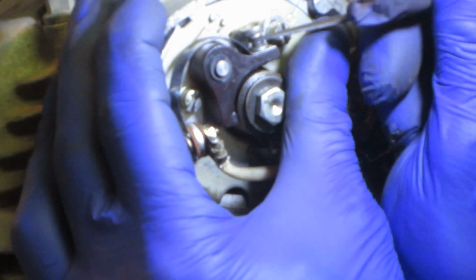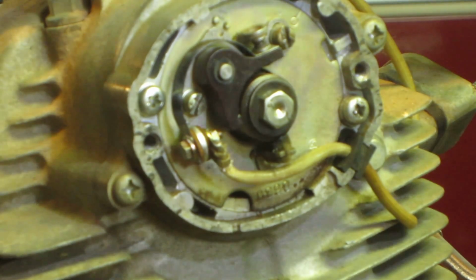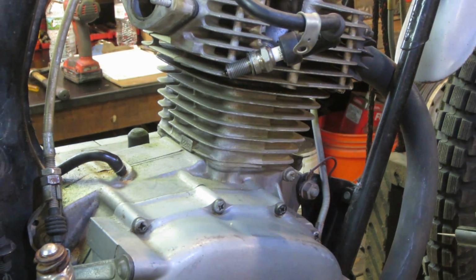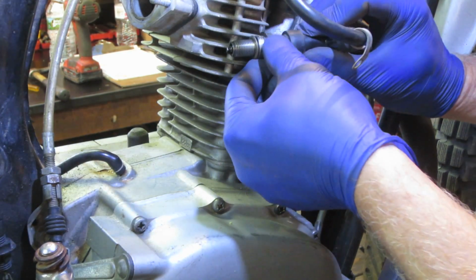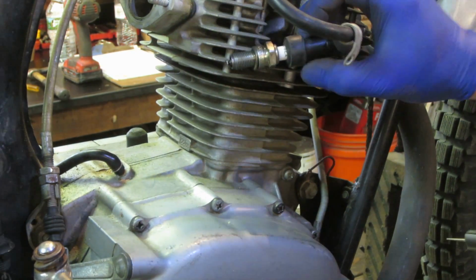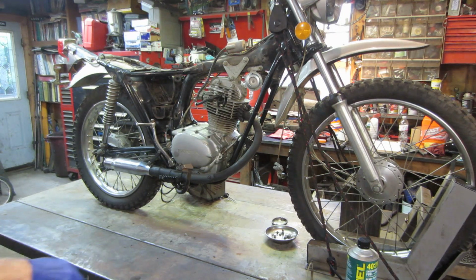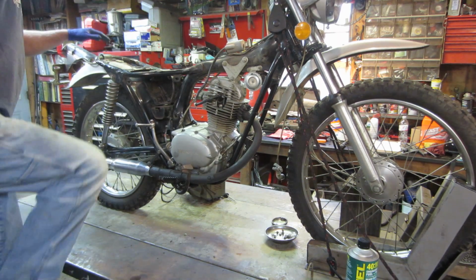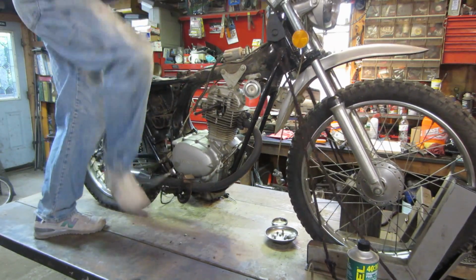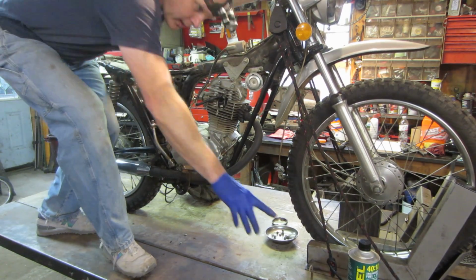I also think I want to take the jumper pack and input power to the battery and see if our weak spark is because we have a dead battery. I got a battery charger on it. Let's see what that does for us. Oh yeah, nice bright white spark now. I think that may have been our issue. Alright, I'm going to put a few more fuel in it. We'll see if there's a little residual in there that'll make it go. Then we'll try dribbling it if not. Let's go give her.